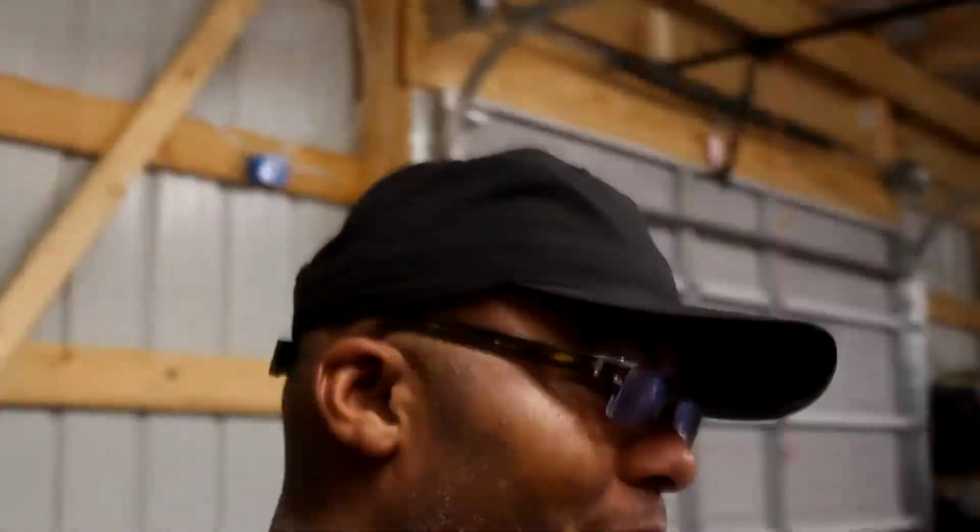The next thing I did is I cleaned off the glass right here. That's going to be going in there soon, but unfortunately it won't happen tonight because I need some screws and stuff to finish off the door handles. You can't put the window in before you put the door handles, or you'll never get the door handles on. Tomorrow, I'll show you guys how to put these on because they are a pain in the ass. These door handles are terrible to put on.